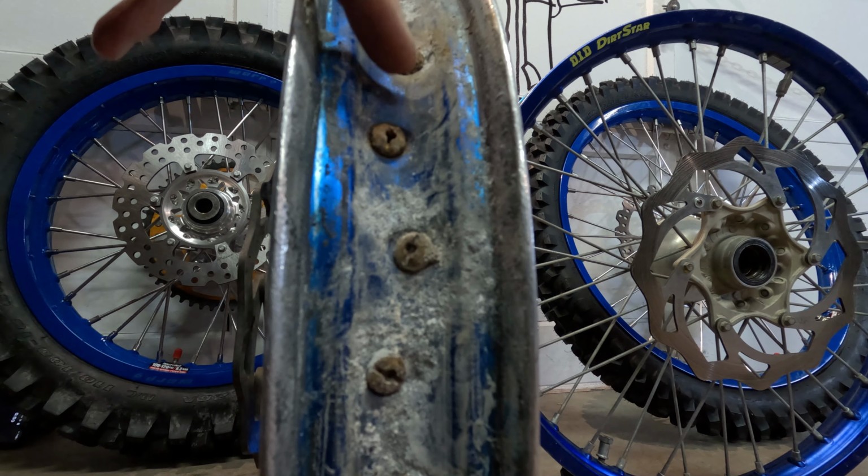Quite, it turns out. So I had two choices as it was presented to me, and my dealers are fantastic. As I've said, they were very open with this. They basically said, you can keep the old tubes and we can reinstall the tires and you can take them home, and those rims will last forever. They're not about to fail. But we do not want to put a tubeless system in there, because the tubeless system will be abraded, eroded, damaged by all the corrosion in there.